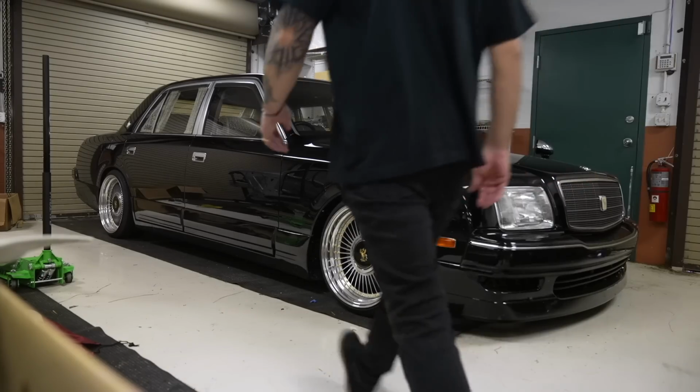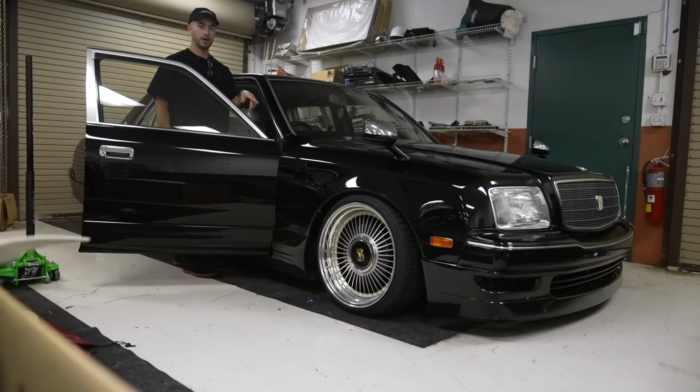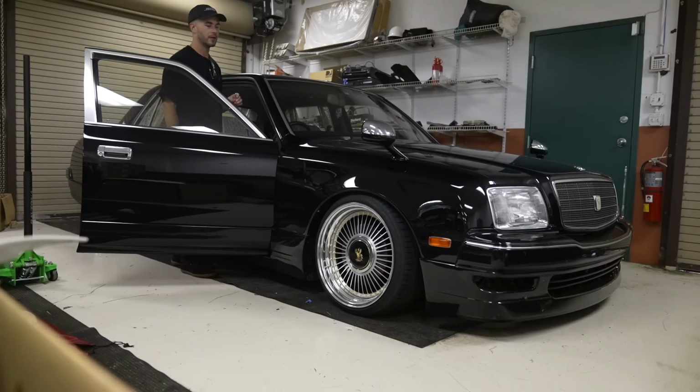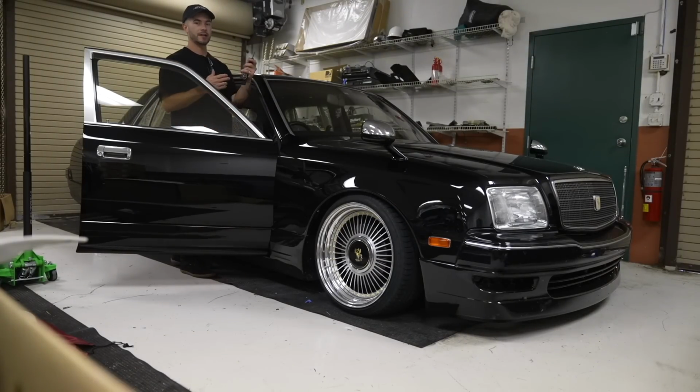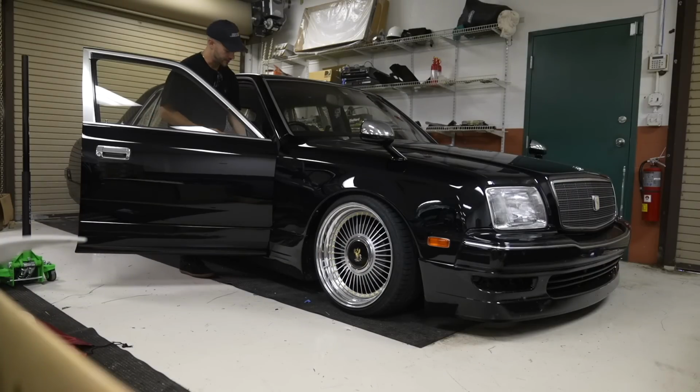All right. So I also installed the RCAs as well. So it's notched spindles and angled spindles to give myself just 2 degrees more camber. I'm not going for any crazy camber. But then also adding those RCAs to the bottom to correct the control arm position. And we'll also get the front end to want to go another inch lower. So even though it won't clear it, it'll kind of force it to go that way. Let's see.